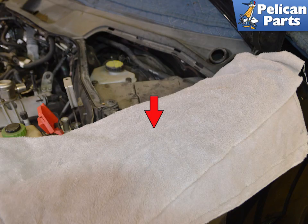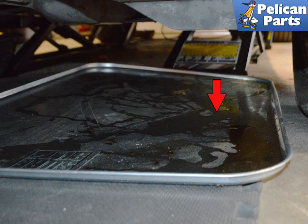You will be draining the brake fluid, which is lethal to any vehicle's paint. Be sure to have plenty of thick cloths covering the painted area around the brake reservoir, and additional rags to clean up any fluid during the removal process. Brake fluid is also highly flammable, so all rags contaminated with brake fluid should be safely disposed of when done.